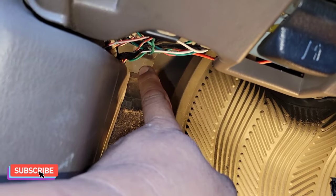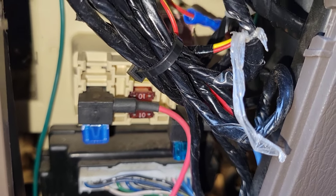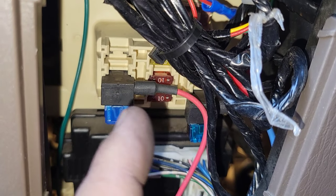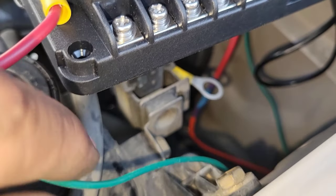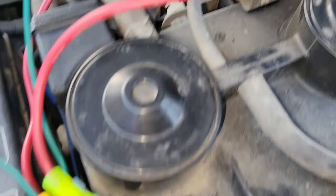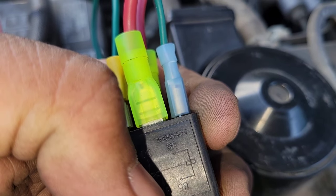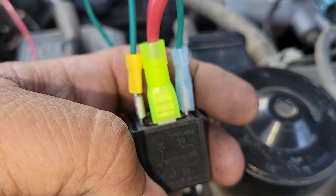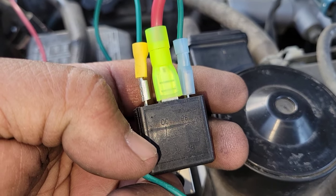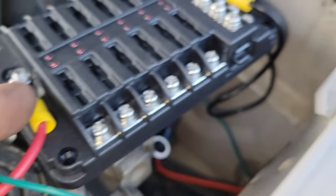I pulled this line in through here and adapted it into this little slot, which I bought at a local auto parts store. That wire goes here — to 86 and 85. It doesn't matter which way you put it, as long as electricity is coursing through the 86 and 85 terminals. The electromagnet inside will turn on, flip the switch, and pass electricity into my fuse box here.